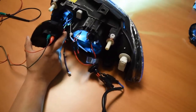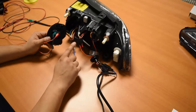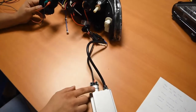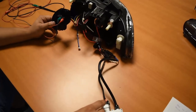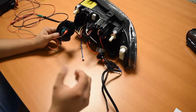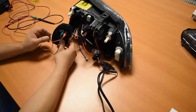Looking through your provided photos again, the one connector that I noticed for sure had incorrect polarity was at the bulb connector. Pay a lot of attention to this: red goes to red and black goes to tan. Also double check the connection at the ballast — that connector goes to a small plastic connector down to the ballast. Check that again to make sure positive is positive and negative is negative. Once that's all set, you will have your low beam. Make sure that polarity is correct on both sides, and you should be all good to go. This concludes this video documentation — thank you very much.